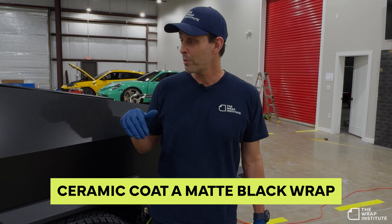You can see from the length of this video how quickly this is done in real time. If you use roughly $90 in product — matte black generally takes more product than gloss film — and factor in your hourly wage, that's a very good return. But it's not all about money; it's about making happy clients and having a great product. This coating lasts 18 months of protection, so the client is going to have a big wow factor and their matte black wrap is going to look good for a long time. That's the benefit of using the right ceramic coating, knowing how to apply it properly, and offering it as an upsell. Hope this helps you wrap better and faster — thanks for watching.